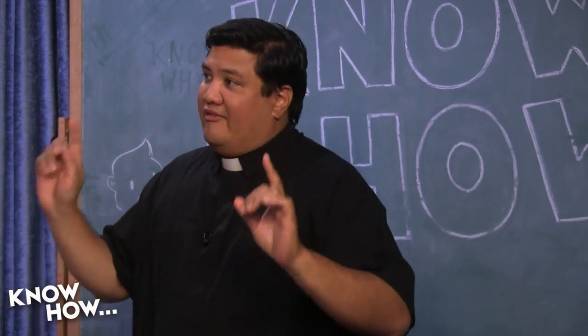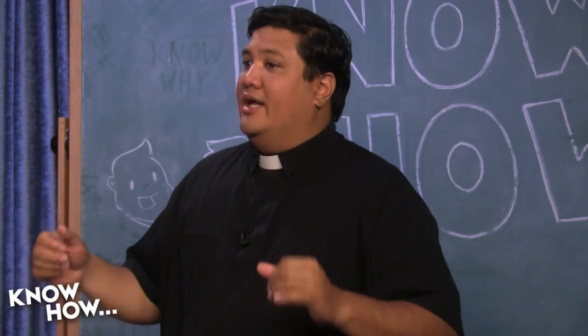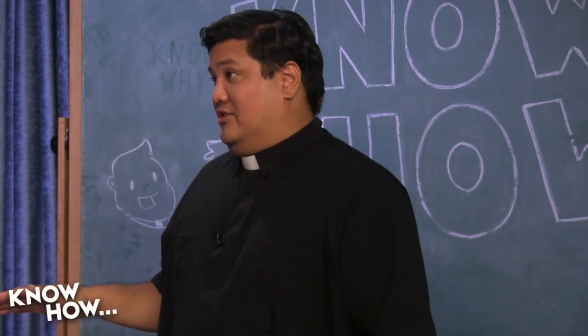Right. Now, if every manufacturer did the right thing, and that is they got their allocation of MAC addresses, and then they made sure that every device only had a single MAC address, et cetera, that would be perfect. Unfortunately, it's really easy to spoof a MAC address. I have software on here that I can make my laptop look like any other device in the world because it's just a combination of letters and numbers that I can send every time I send a frame out. So that's not a good security feature. But okay, we're not talking about that. We're talking about this situation.